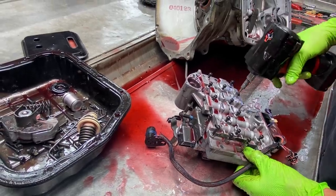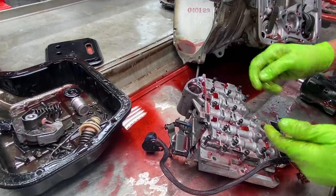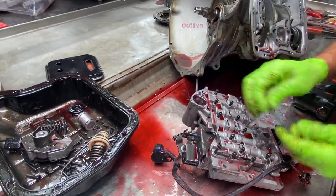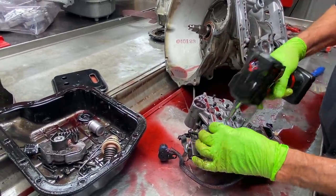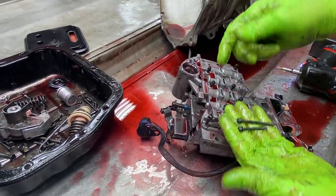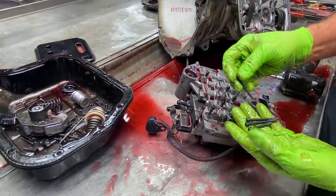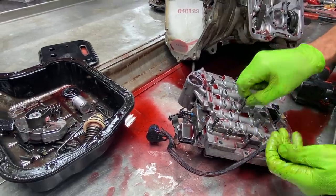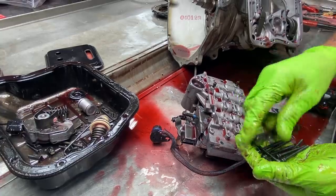Now we'll be putting a spacer for the filter on here. You'll be using this bolt back, and then the spacer for your filter will go in these two here. So you will be using that bolt back. The other two you will not. This bolt is shorter than all the rest of them, you can see. Now some of the ones will come with a long bolt here too. So don't freak out when you see that, because I have seen them come in the door that way.